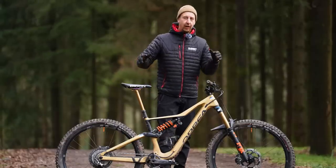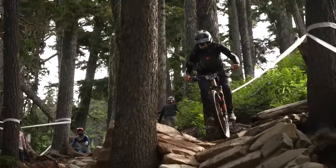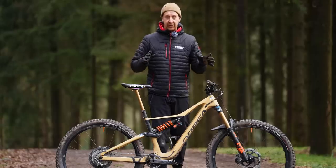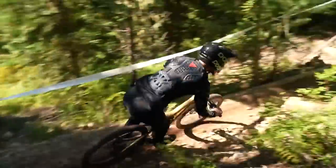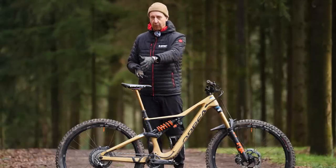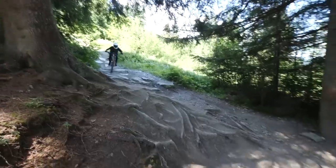Enduro and gravity riding and racing — I've grouped these together because it's the hardest stuff on the bike. Enduro might just have the edge, as I think it is as hard if not harder on wheels and tires than downhill racing, due to the fact that in downhill the bike just has to survive getting to the bottom of the mountain, whereas in enduro it's got to survive multiple runs and just takes an absolute beasting. They are very similar products though — the rims more often than not are the same between downhill and enduro; it's the hubs that differ. The rear hub on most enduro bikes will normally be a 148mm boost hub, whereas the downhill setup tends to run less gears and a much wider spaced hub at normally about 157mm with different flange spacing.